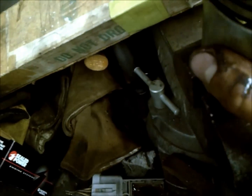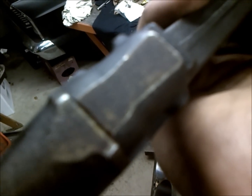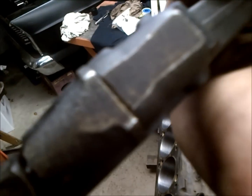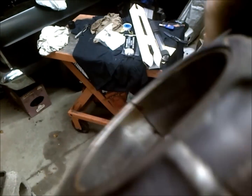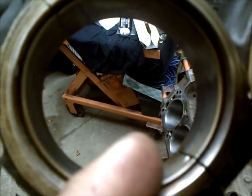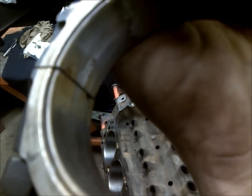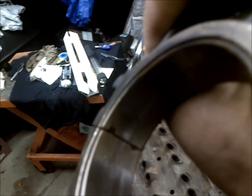So, one more thing here, all these pistons are generally numbered. Sometimes they're numbered from the factory. You really can't see it, but there's a very faint 8 on both this rod and this rod cap. And you want to have these lined up. A good way to tell your rod caps are on correctly is you see here that on each side of the rod cap, this lip is different. So you want to make sure you have the proper lip on the proper side of the rod.